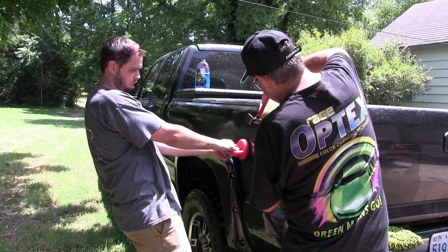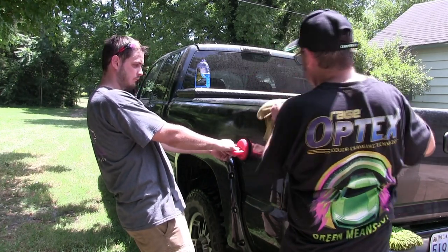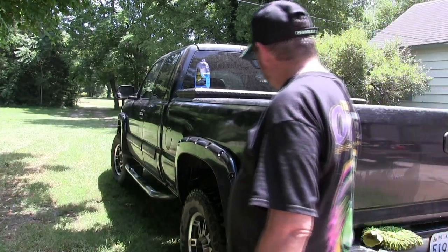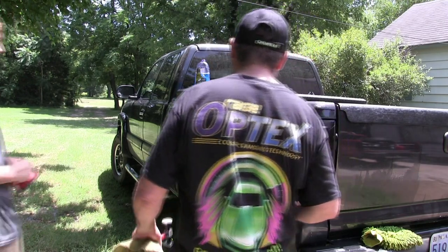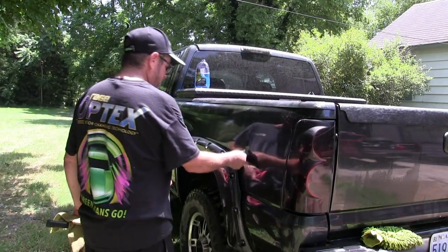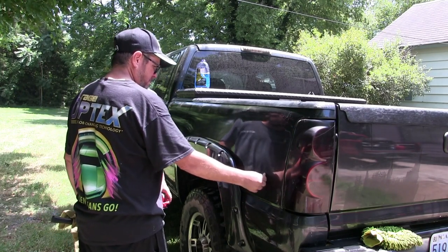Make sure you use your hammerhead hitting flat on the surface so you're not putting dents in it. Always brace yourself if you're pulling — you can see he did catch himself. Don't be pulling too hard without paying attention in case that suction cup pops off. And that's with any type of dent pull.